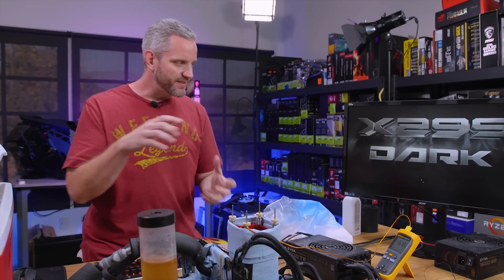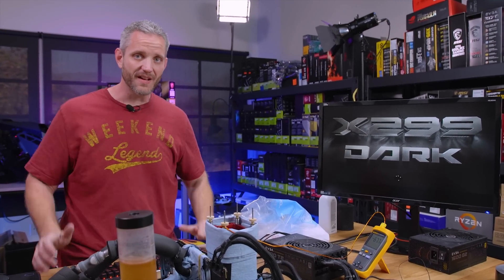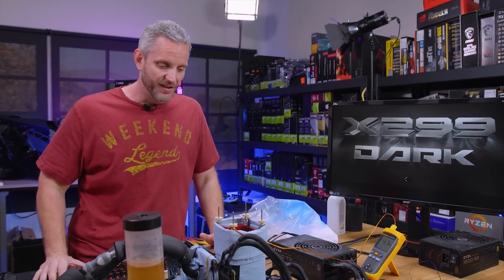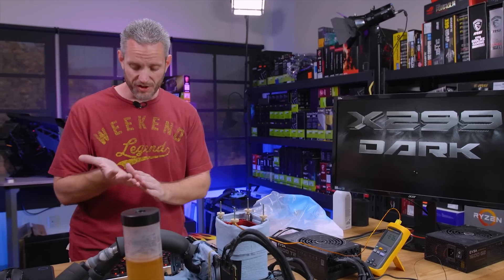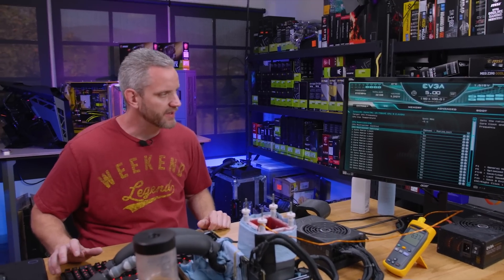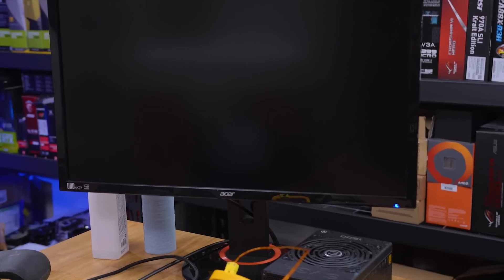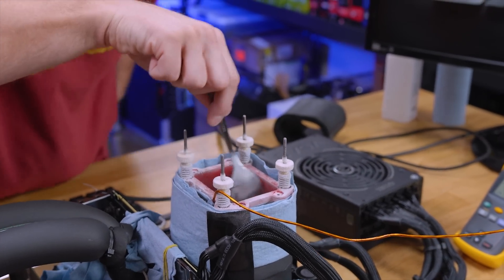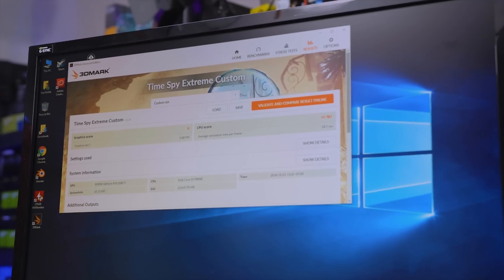In all fairness, this pot is not exactly meant for dry ice. The two-piece design is probably allowing some acetone to get through the sides — I should have taped it and I didn't. So we're dealing with acetone just everywhere; fortunately acetone itself is not really conductive. It's now dripping under the board. XOC overclocking is not that much different from regular overclocking — we're basically going to bump it up incrementally, starting at 5.2, while my main job is to regulate temperature and keep everything in safe zones.